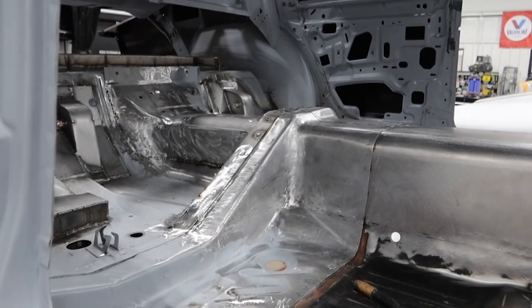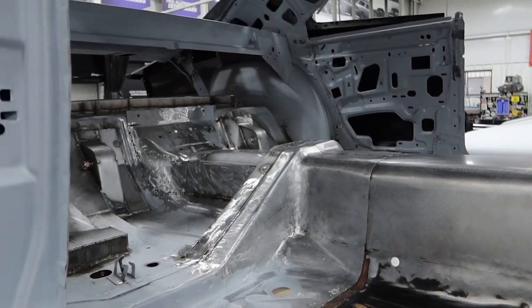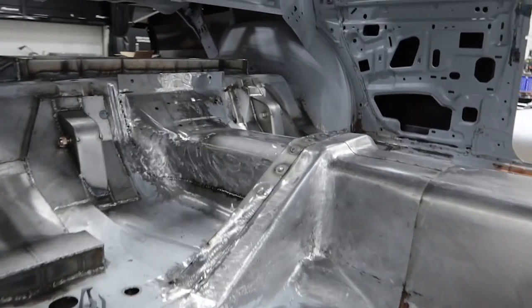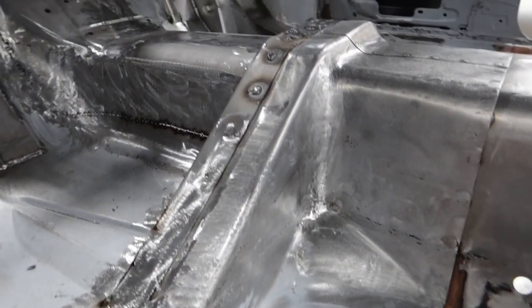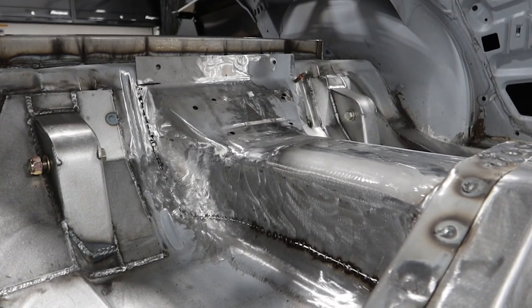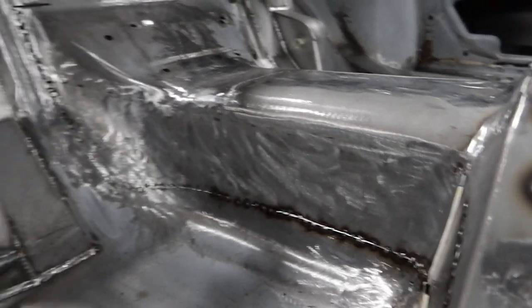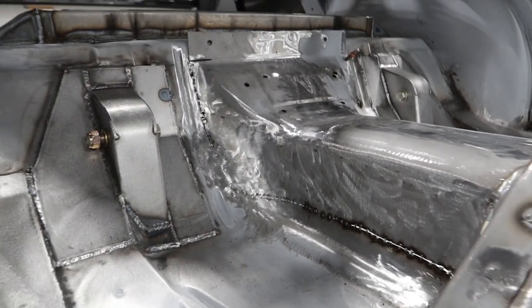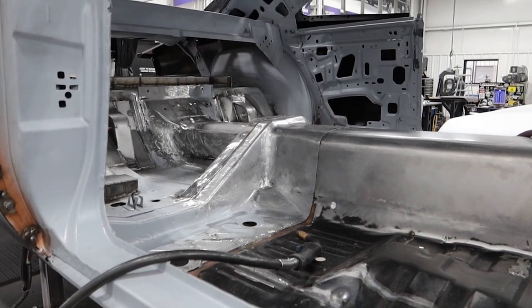On Chris's Daytona, Mark is still working on the tunnel. Everything needs to go up for the driveline on this vehicle since we're going to have such a low ride height. Towards the back, he put in a brace, and there's going to be a little more room back there for the center section on the axle. This part's going to be clearance for the drive shaft and a little bit of room for the center section as well. Mark's making very good progress on that.